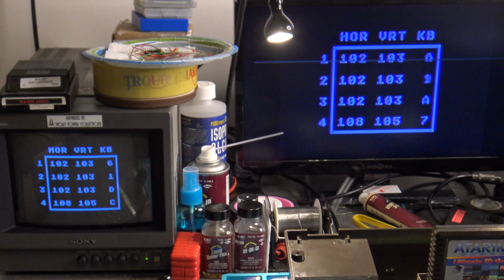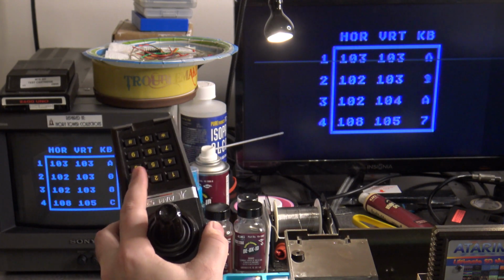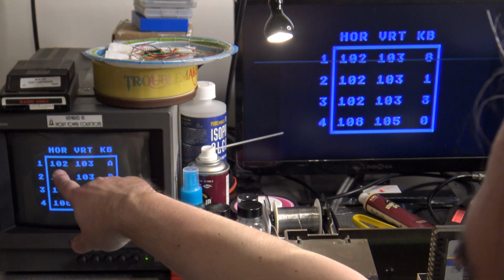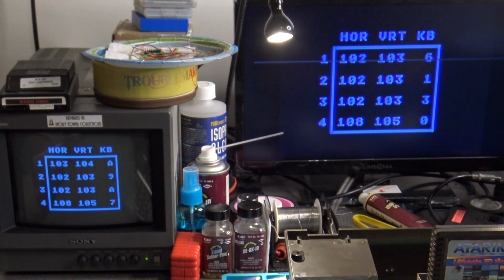That's because this test board is actuating all of the different character control codes that would be done off of the keypad itself. But the part we're most concerned with is the numbers for the horizontal reading for controller port 1. The factory specific settings using this diagnostics require you to set that horizontal reading to about 112 plus or minus 1 or 2. So anywhere from around 110 to around 115 should do the job, but the closer you can dial it in to exactly 112, the better.